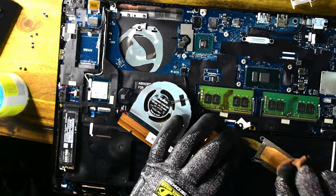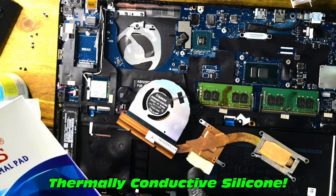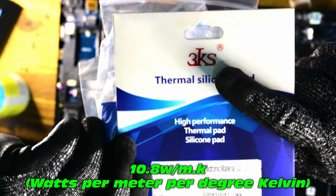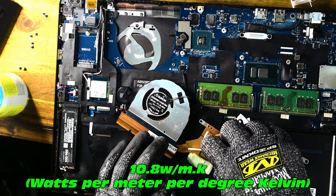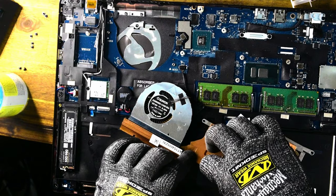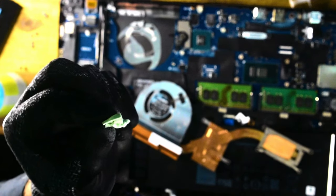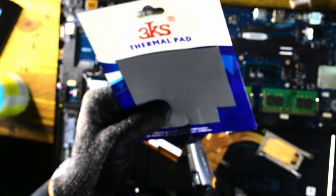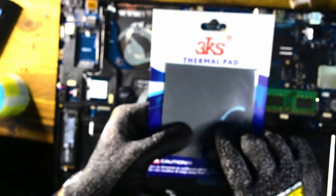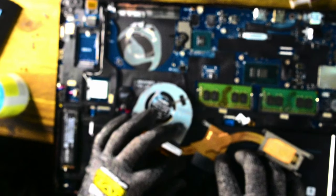The most logical thing to do next is replace that thermally conductive thermal pad. This is a silicone-based pad which is really good at conducting heat — these normally sit on top of your RAM for the GPU. This is a 10.8 watt per meter kelvin thermal pad. You get different ratings for heat dissipation ability — this one is relatively decent, in the middle range, and relatively cheap. This particular pad still feels and looks really good but we'll replace it in the quest for performance.